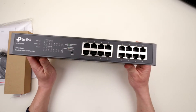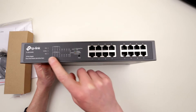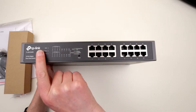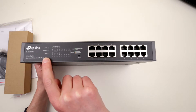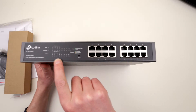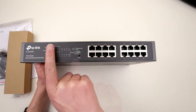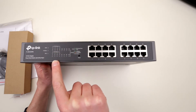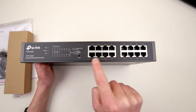So how does it look? On the front we have 16 ports, a whole bunch of different indicators, and a reset button. There are indicators for power, and POE MAX — I assume that's going to be shown when Power over Ethernet maxes out the power consumption. Then we have different port indicators corresponding to the ports, and only these eight have Power over Ethernet indication. That second row on top corresponds to these eight ports over here.